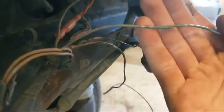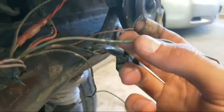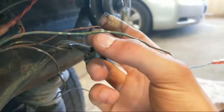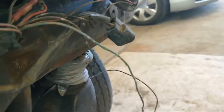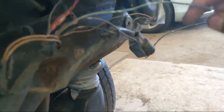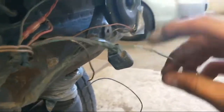It's split over here now. I'm gonna cut it back here, where the insulation's rubbed off, because it's the best point. Maybe cut it a little bit ahead, and then strip the wire off and utilize that. Well, actually, I'll try to strip it first, pulling the wire forwards, and then cut it somewhere around this area, because I don't want that.